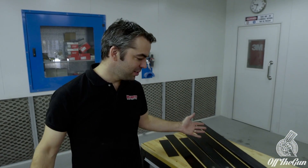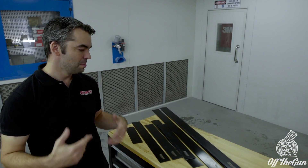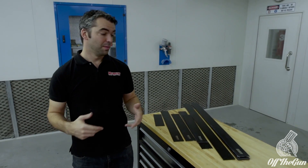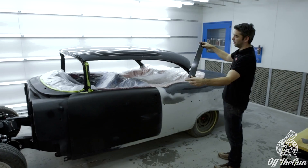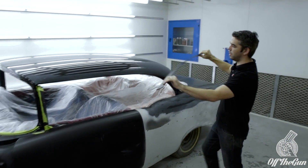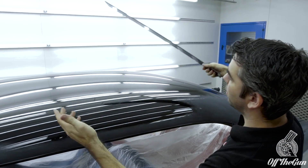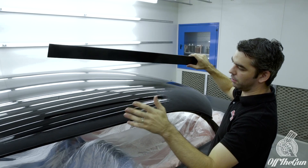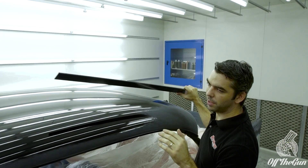Here we've got a few splines — various lengths, various thicknesses. The best way I can describe it is that you've got to choose the right size for the right surface. Bigger, flatter surface: bigger, thicker spline. Smaller surface with more shape: smaller, thinner spline. We've got this car here — it's a '57. I'll grab this one here, one of the four-length splines. It's about an average sort of length, and you can see how the tool itself is a little bit rigid but gives a fair bit of shape. What we're looking for is the edge of the tool gives us the goal, gives us the shape — it's going to tell us where we want the surface to be when it's finished.